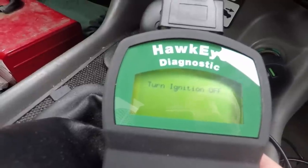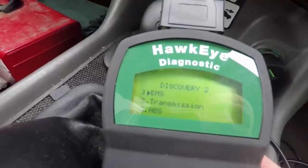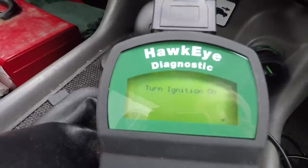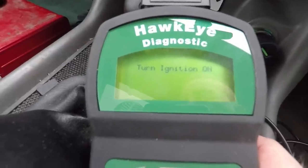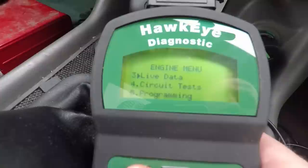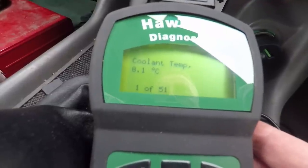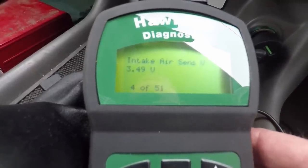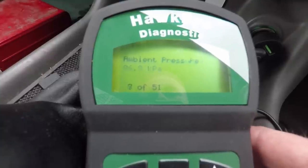Let's go and check the live data. Going into EMS, TD5, turn the ignition on. Live data — coolant temperature: 1.8 degrees C. You can see the coolant sensor voltage. You can go through all the systems here and see what the current readings are. There's lots of information — you can just scroll through and find what you want.